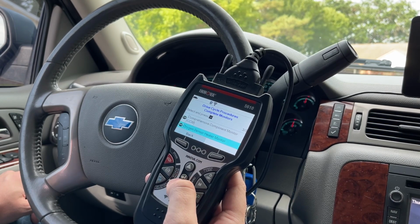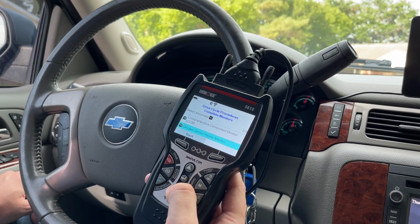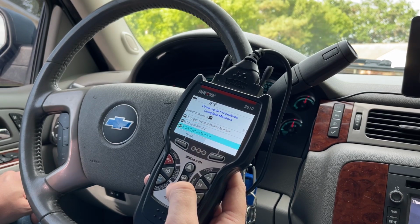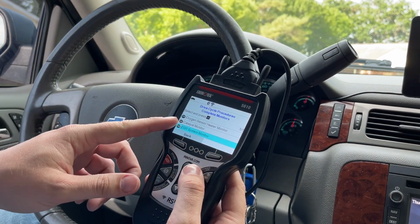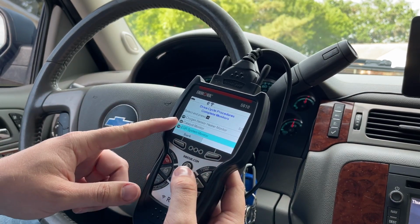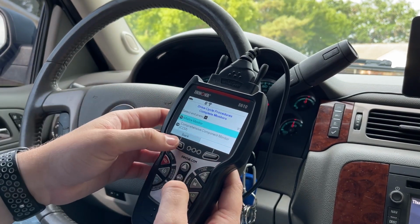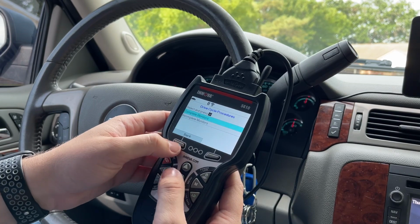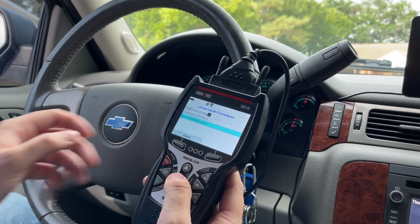Oxygen sensor heater monitor. This truck has 4, your upstream and downstream, 2 and 2. The EGR, your exhaust gas recirculation system monitor, and then the catalyst monitor. You have 3 cats on this truck. Only the front 2 get run for the monitors. The third one's post oxygen sensors. Let's go down to incomplete.